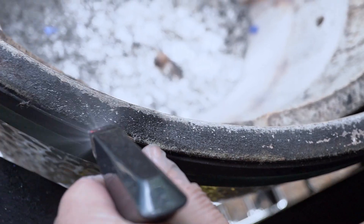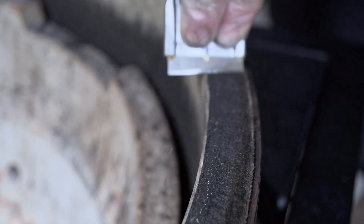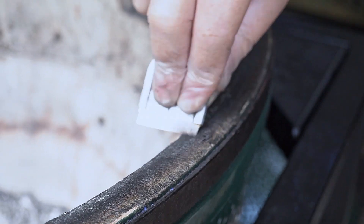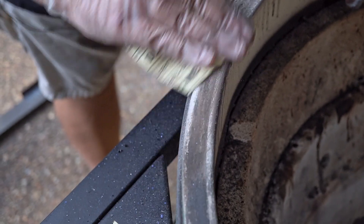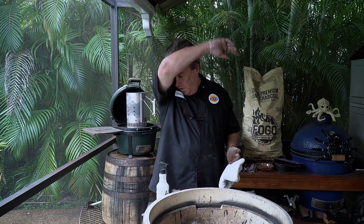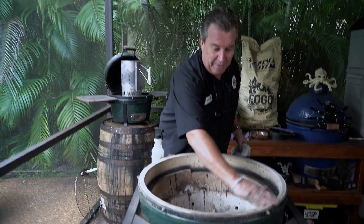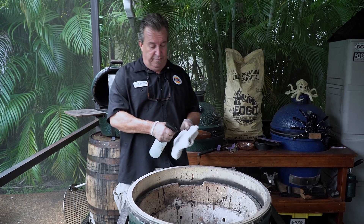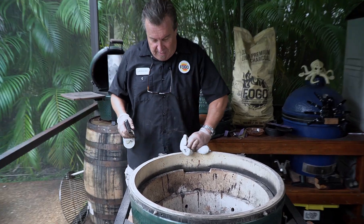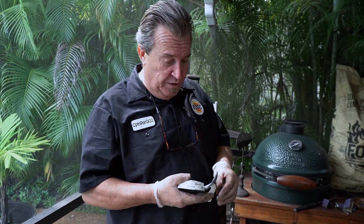We return for another trip with the acetone and give it a little scrape. You may not get all the way down to clean ceramic — that's okay — but we're getting a nice clean surface. Whew! That was a little more work than I was in store for, but we got it nice and clean, all the way back down to the bare ceramic. That's what we want. The last thing is to take the acetone again, give it a little squirt on the towel and wipe up any excess. We don't want any sand, grit, nothing — we want it to be perfectly clean.